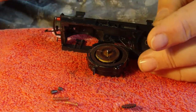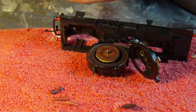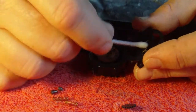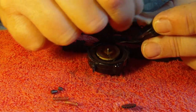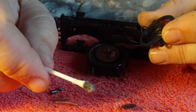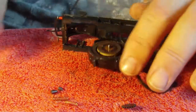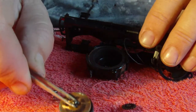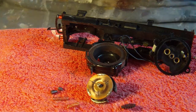There's the brushes - one's a little bit more worn than the other one, which is a little strange, I've never come across that before. If one spring's pushing down just a little harder than the other - we're just going to clean inside this case to remove any deposits. Oh wow, it's very black. That was just from inside this motor case - wow, that's black. We're going to carefully remove the magnet and clean inside that as well, which is probably going to be very dirty too.